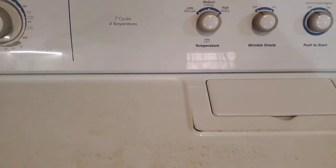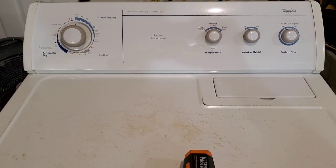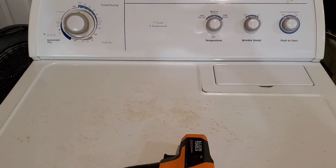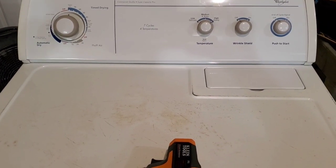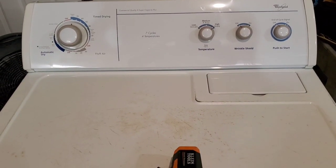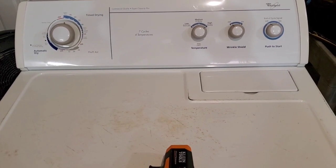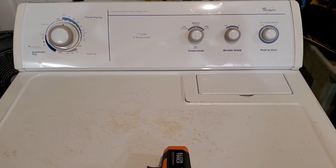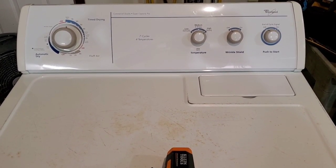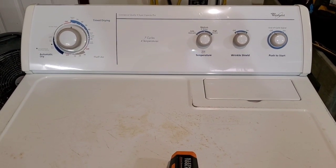We'll stick it on high to get those clothes nice and dry. You always want to make sure on the back where the hose goes — from where the hose hooks into the wall all the way out to wherever it shoots out outside the house — make sure you get that cleaned as well. I use a leaf blower, but it's very important, especially if your old dryer stopped heating correctly or it took two or three cycles. A lot of that can be internal buildup in the dryer, but nine times out of ten you can put a new dryer in there and still have trouble getting the heat you need, and that's because you've got a clog in your ventilation. So while you're swapping out your dryers, make sure you get that taken care of as well.